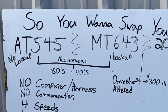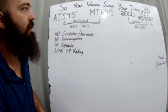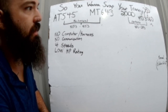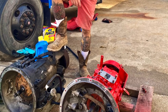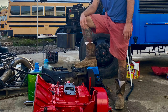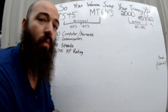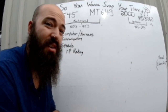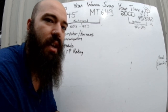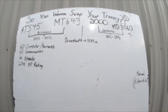Another issue you're going to have with swapping your transmission is your drive shaft — nine times out of ten it won't fit when you do a transmission swap. During our swap from the 545 to the Eaton five speed, I measured and found the Eaton was a half inch shorter than the Allison 545. We thought it would be just enough room to pull the drive shaft forward, but once we got everything up there it was about an inch off. Anything under a half inch is reasonable to pull the shaft forward, but nine times out of ten you're going to be altering your drive shaft, which should cost around three hundred dollars.